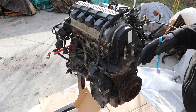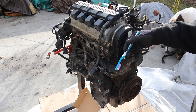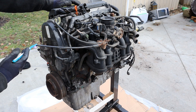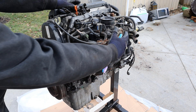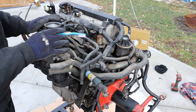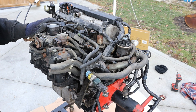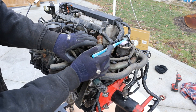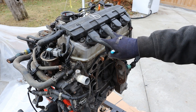Taking a quick look at the layout of this engine, the front of the engine actually sits on the driver's side of the vehicle as opposed to most 4-cylinder front-wheel drive vehicles. You'll also notice that this engine has a plastic timing cover because it's driven by a timing belt which often likes to fail. We've got a plastic intake manifold with a mechanical throttle body linkage. Coming around the back, the most important thing to note is this VTEC solenoid because this is the VTEC version of the D-17 motor, being the A2.